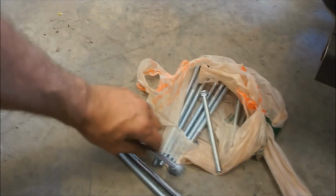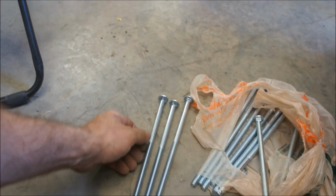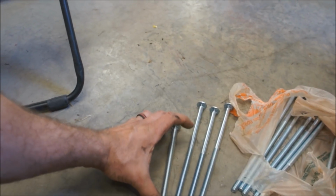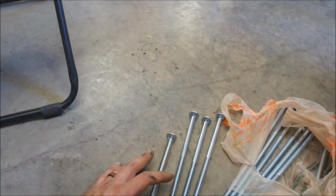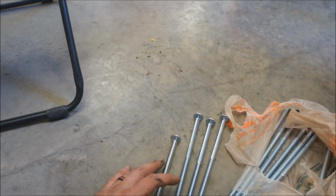I went to basically a hardware store and bought just really long ones. I've got a couple of short ones. These will be probably for the radiator support. You can get online and find what size bolts, but I went longer on all the bolts than it specifies, because I knew I was going to do the 1/2 inch body lift. So yeah, get your nuts and your washers and stuff like that.